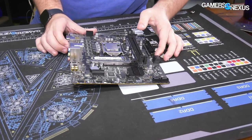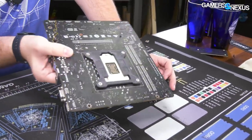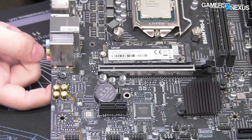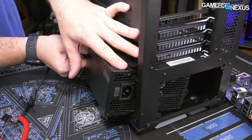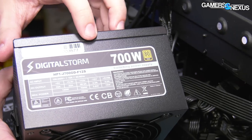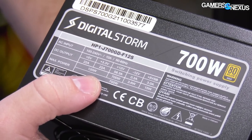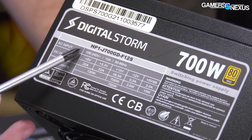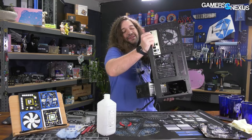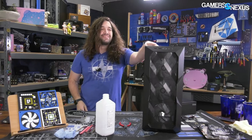Fairly standard — it's an off-the-shelf motherboard, which is a good thing. They haven't done any weird proprietary stuff. There's a standard x16 PCIe slot, and there's a screw just stuck in there that I'll dislodge later. The PSU is 80 Plus Gold, 700 watts. A lot of people think 80 Plus means more than it does in terms of power capability — maximum power is 700 watts, and you can get all 700 on 12 volts. That's great. Andrew has informed me that the case needs to be turned around because in his words, the case's butt is facing the camera and that might get us demonetized.